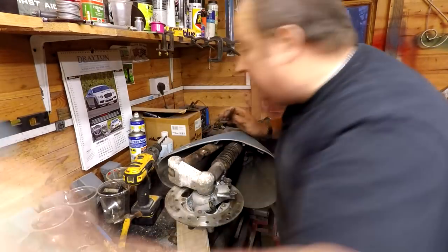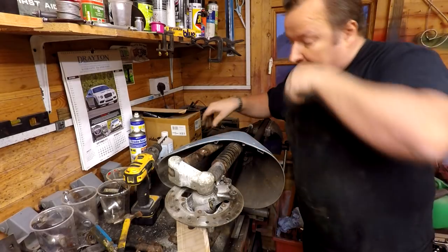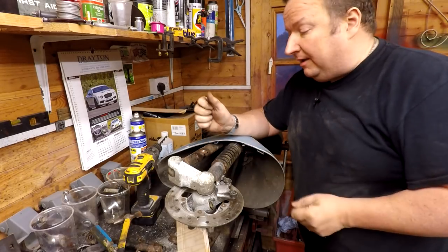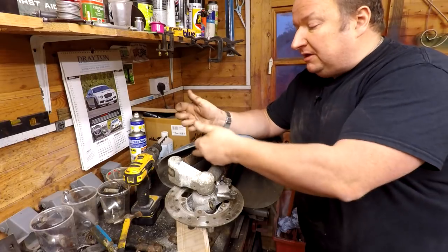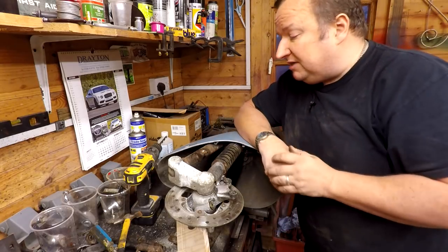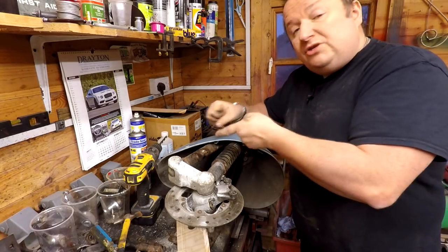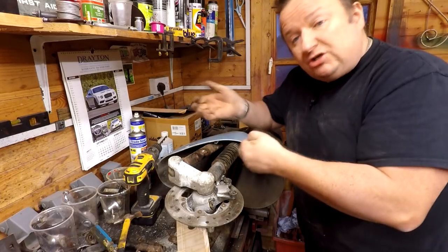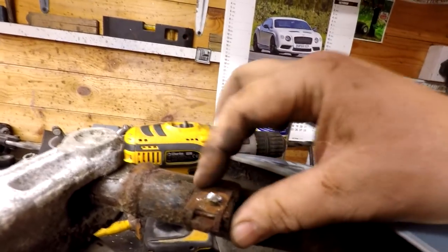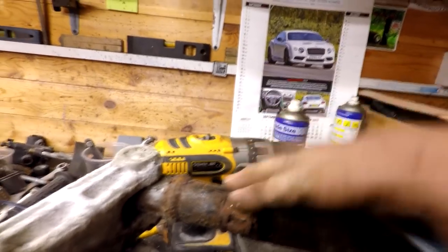I've been pretty lucky with this one. I've got it off without damaging the actual plastic, so I'm happy with that. What can happen — as you saw me tapping away there — is that behind it there's only a thin alloy bracket and you actually snap the lugs off. You'll find a lot of these cheap mopeds where people have tried to take the mudguards off after two or three years when they've all corroded and they've broken the lug behind it. I'm pretty lucky here because it looks like these are just little metal clips that sit over a bracket, so I can file that flat, grind this off, and put a new metal tag over the top with a brand new screw in.